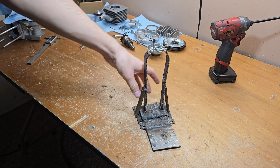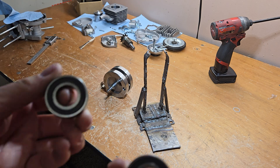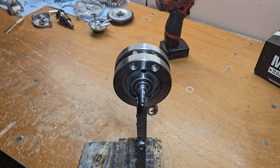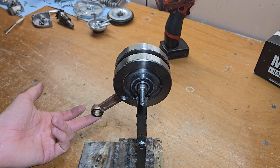Now I need to find the current balance factor of the crank. I need to build a better stand, but for now this will do. I like to use oversized bearings to reduce the amount of friction possible. There's an issue with cranks with four holes, two on each rib — the rod falls down, which is not supposed to happen. You can't hang weights to the rod this way.